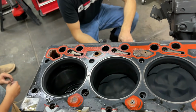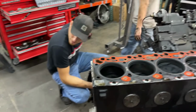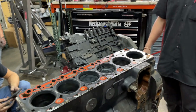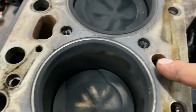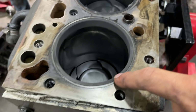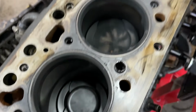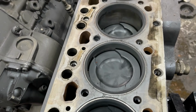Now I can't wait to see what kind of rods we have in here. What did they say we have in here, Reed? I'm not too sure. You wanna play a game? Yeah, sure. I'm gonna go 12 valve rods with the upgraded rod bolt. And then we have a square cut firing ring. It's kind of old school, really dates this engine build. But hey, the good news is the piston spray doesn't look terrible. Pretty decent injector in there.